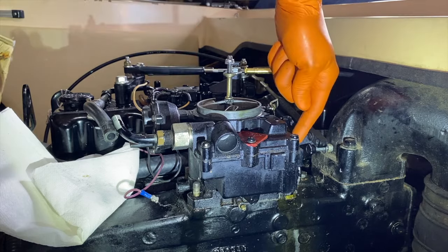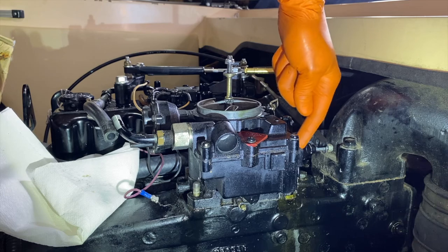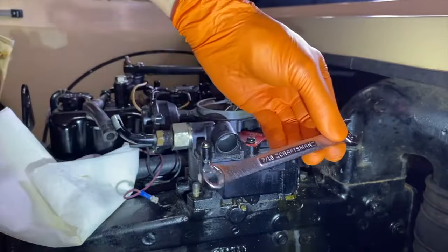And as you remove this fourth and final nut, if that's the one you do last, you'll get to a point where your 1/4-inch ratchet and socket will get stuck if you're not careful. So loosen it to a point where you can carefully and conveniently remove the ratchet and socket and then transition just to a standard wrench.